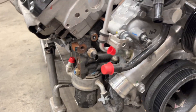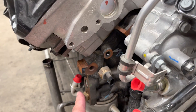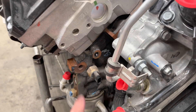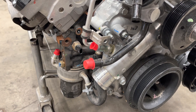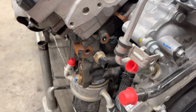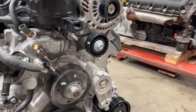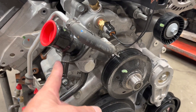It's got the sensor for the fan — for the Camaro fan. Now I don't know what I'm going to do because here is the oil cooler. This little cooler's not good and it won't work anyway, and this sensor's not good either, so all that stuff has got to go. We're going to use the JL cooler, which will kick it out front. Maybe I can use this hose and tie it back in somehow — I haven't figured out all the logistics yet.